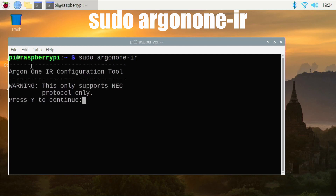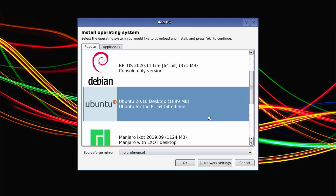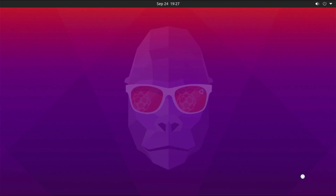If you want, you can run Raspberry Pi OS from your micro SD card and use your M.2 slot as mass storage. Alternatively, you can run BerryBoot and install multiple operating systems between your SD card and your M.2 drive. Here I'm running BerryBoot and I'm going to install Ubuntu onto the M.2 drive, so once the installation is complete I can have two different Linux-based operating systems on one device.